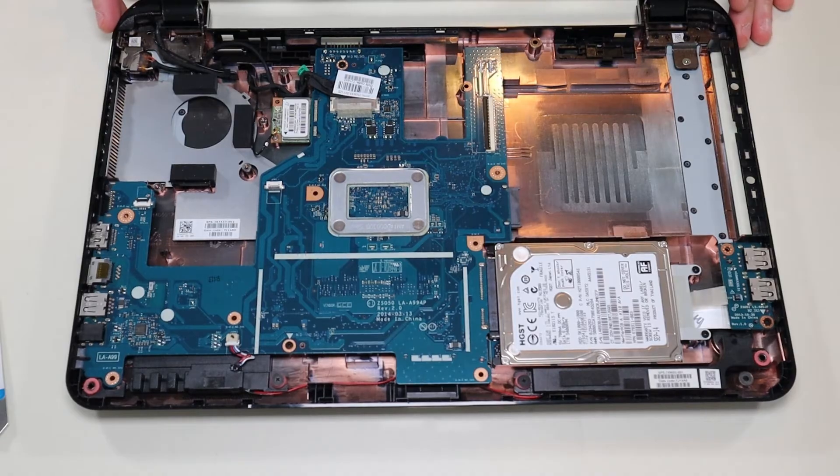This is what you're looking at for the inside of your computer. Unfortunately, in this horribly designed computer, the CMOS battery as well as the RAM is located under the motherboard — it's on the other side from what we're seeing here. So to get at the CMOS battery, we have to actually uninstall everything, unplug everything, flip the motherboard over, and then access our CMOS battery.